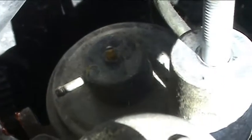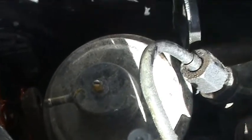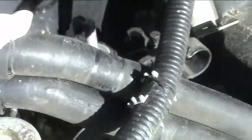Right, as you can see, that's in there. It's not bolted in or anything, but you can see how much more space I've had to work with by taking the intercooler off to get to it. It's made a hell of a lot of difference. I can get straight down, dropped it straight on. There she is, sitting pretty. Now all I've got to do is feed everything in and bolt it up. So, take the intercooler off. So I'll show you where we are now.